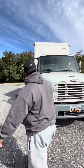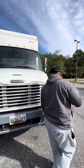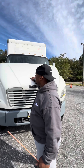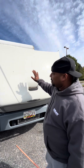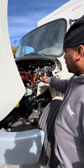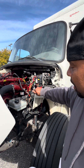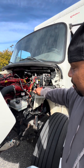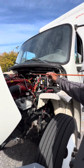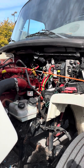I'm going to walk on this side of the vehicle and unlatch the hood, then walk on the other side and unlatch it there too. I'll pull the hood back. When I pull the hood back, I want to explain to the instructor that the hood is sitting level, tight and secure, and it won't rock back on me. Back behind there — if I can physically see it — is the power steering pump. I'll tell the instructor: if I can see it, I'll make sure it's tight and secure, properly mounted, and not leaking any fluids. Remember, anything that carries air or fluid should be checked for leaks. Here is my oil dipstick — the proper way to check oil is to pull the dipstick out, wipe it clean, stick it back in, pull it back out, and make sure it's above the add mark.